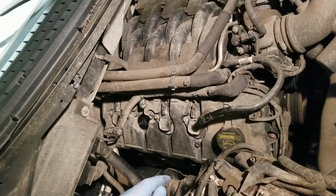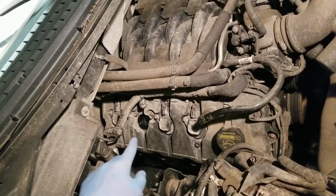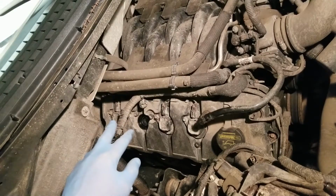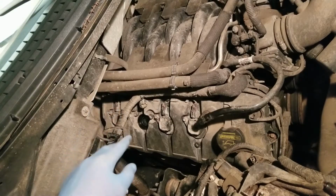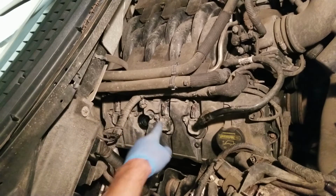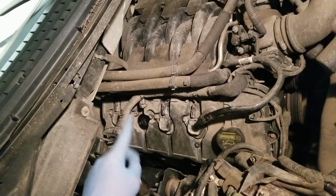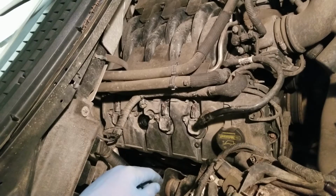So anyways, here's what I did to troubleshoot this guy. I pulled cylinder 3. The coil pack comes out with it. All right, so I'm thinking, oh, well, the coil pack's the next thing in line. Here's what I'll do. I'll pull cylinder 3 and I'll pull cylinder 2, and I'll switch the plugs, but not switch the coil pack, okay?